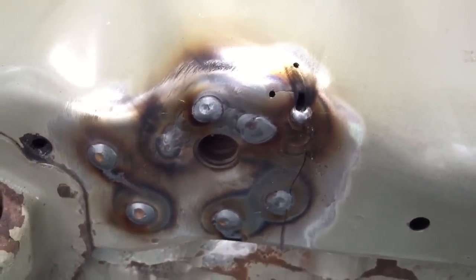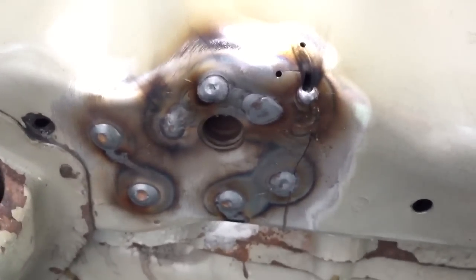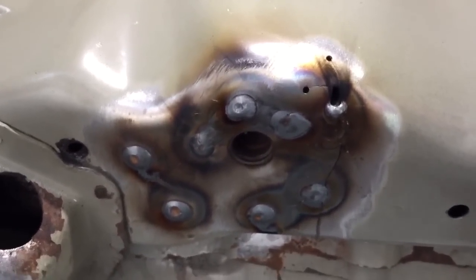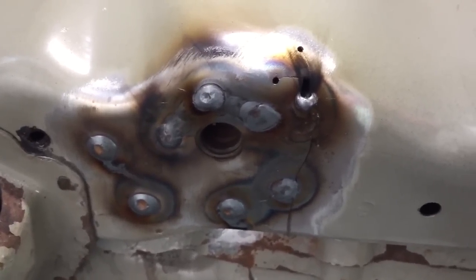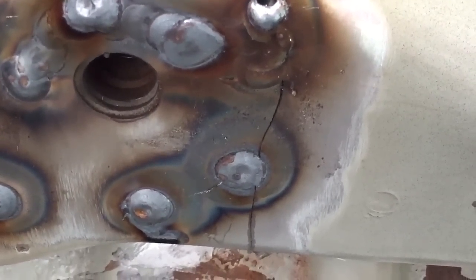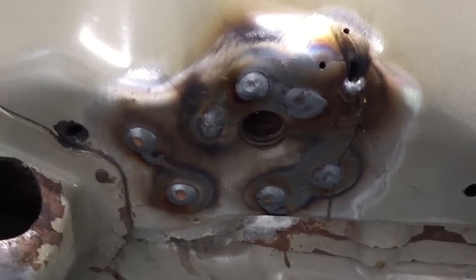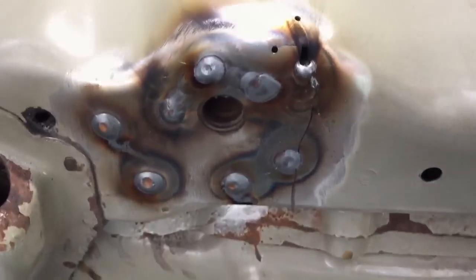That's partway through the crack repair on the right front plate, and lots of people just think it's obviously just welding over cracks, but as you can see, we've made positive connections from the internal platform where the threaded mount is to the outer skin, which is the one that's cracked. And as you can see, we haven't even yet covered over or weld repaired the actual main crack. This is just the extra work that we do from the knowledge of how we can improve the connection between the inner and outer panels. And now we'll go on to actually repair the crack itself.